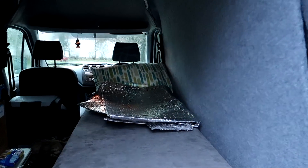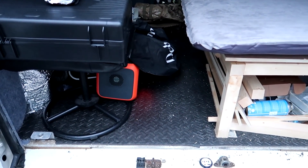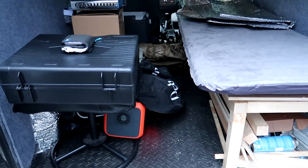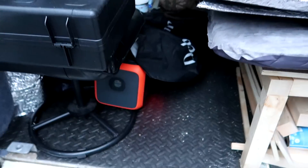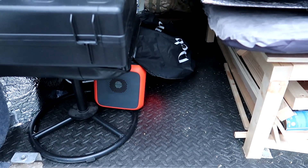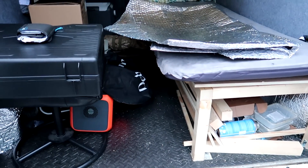I'll open up the back. You can't see much at the minute - the stage I'm at is what I've done so far. I'll start from the beginning. I cleaned everything, took the boarding up, and sound deadened the floor. The floor itself - this insulation is your first layer, stuck on using trim fix. Then from Halfords these interlocking mats - I couldn't think what they're called - which add a bit of insulation to the floor as well. Then I'm going to put some vinyl down to colour-match.